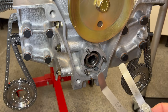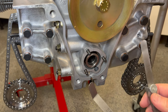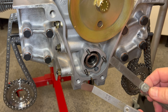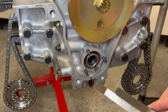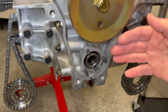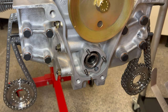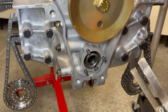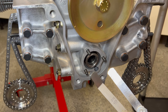Hey guys, so today we're going to do a short little video on the intermediate shaft end play and how to get to some kind of a measurement. I'm going to be using feeler gauges to try and get there. The main thing here is that we just understand what's going on with the end play and how we get to the proper equation. So let's take a look at the page out of the manual that I printed out and see exactly what the measurement is for this engine.